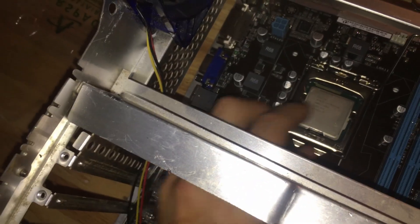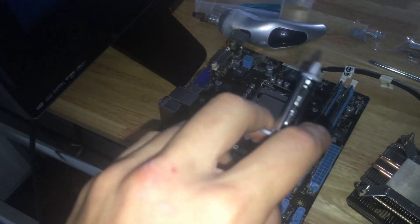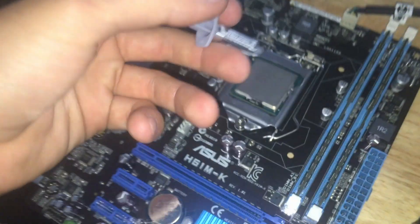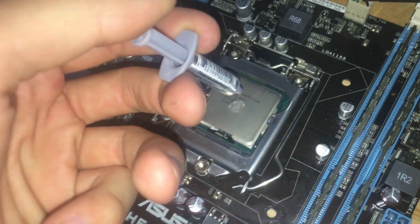You see these little notches on the left and the right? You're going to align that with the notches on the socket. There's one notch right here where the shadow is, and then the other notch is right here. Gently place it in there — you don't want to damage any of the pins on the LGA motherboard. Don't forget to apply the thermal paste. I bought this Arctic Silver off Amazon for about $5-$6. Just dab a little bit in the center of the CPU — like that should be good enough.